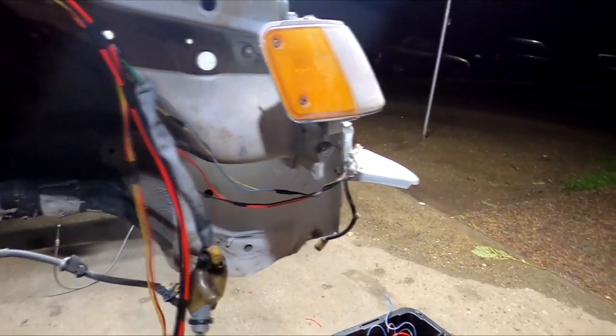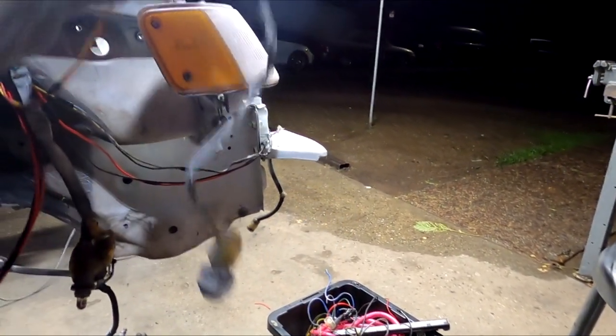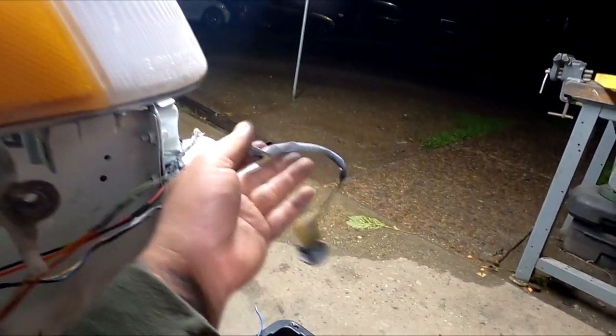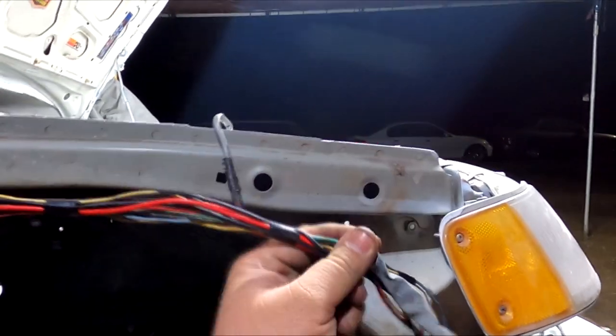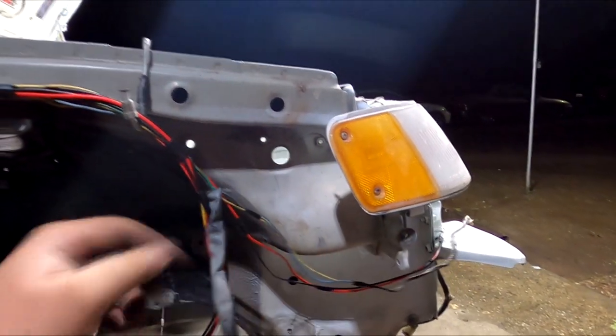And then we have this one right here, goes to the front bumper lamp on the bumper itself, so that's extended past the bracket, so that once the bumper is in place, we can bring the harness out of the bumper and then install into the lamp, and then lamp to the bumper. The junction of all of these is probably going to be about right here, so it's going to be solid loom up to about right here, and then it's going to split off into each individual wire to their home locations.